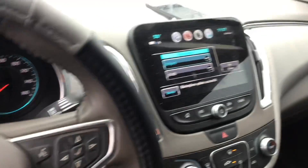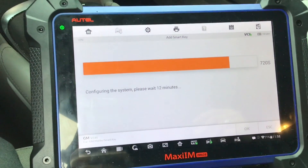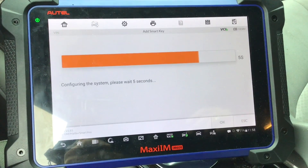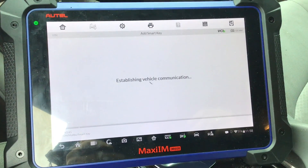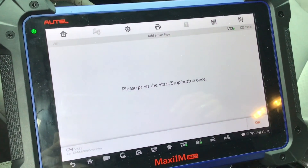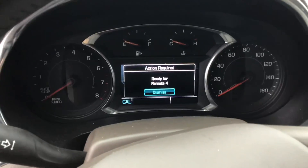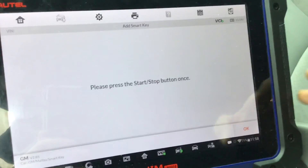We're almost at the end of our 12-minute cycle — she's on. We got our immobilizer right there and we have our new key in the slot. It says ready for remote four, so there are already three keys in there. Press the stop button once with the key in there — you want to see the count jump to five. Ready for remote five — the vehicle took the remote.